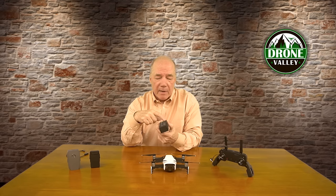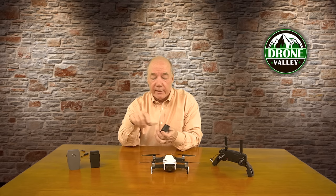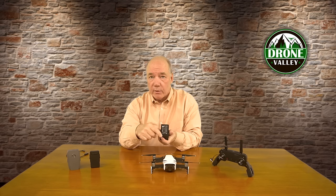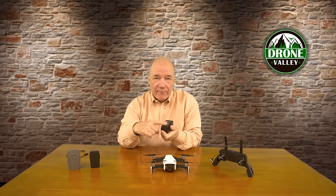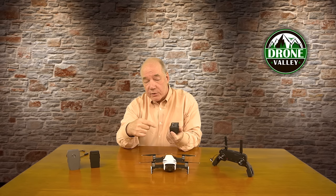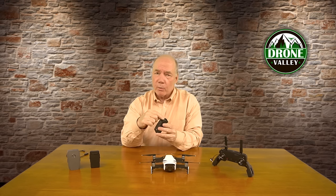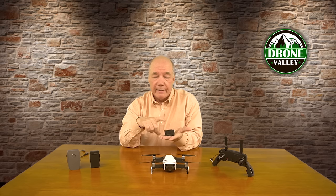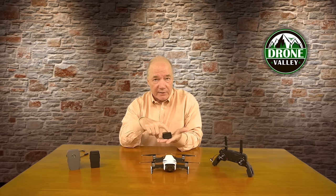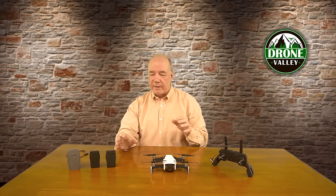Another thing to look at physically are the battery connections. The circuitry inside is monitoring the cells and knows exactly how much current potential is available, but that current has to get out through these connections to the drone. If you've put the battery in grass, debris, or your case, you may have picked up fuzz on these connections. I recommend taking a new toothbrush and cleaning these off — run it across the contacts and do the same inside the drone. If debris gets on there, especially if it's wet or salty, it'll corrode those contacts over time.